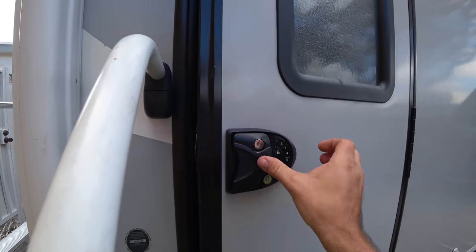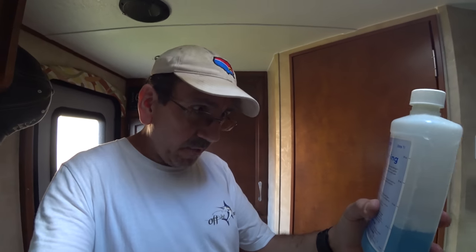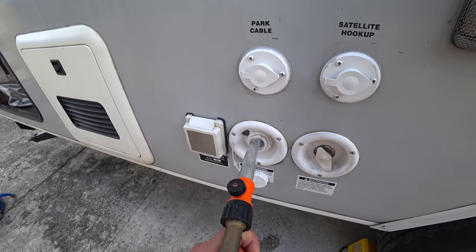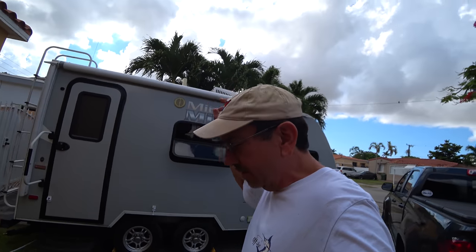That's a beautiful sound when it closes properly. So step one — cleaning: empty the tank, and add one ounce of concentrated detergent for every four gallons, then fill tank with water. Oh, I was supposed to add this first. I have a little over 40 gallons, so I'm just going to do like 10 ounces — probably what's left in here. Now I'm supposed to fill up the tank completely and then run this water through all the faucets so it cleans all the plumbing inside. And it looks like it might rain — this sort of thing always happens when I want to do an RV project. I also want to put that Togo antenna on the roof today. We'll see.